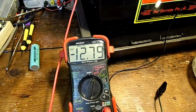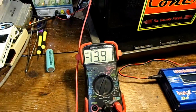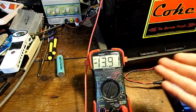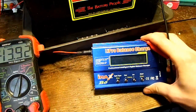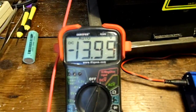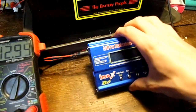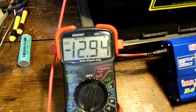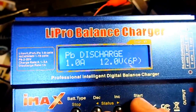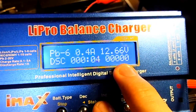So let's top off the voltage, then we'll do a discharge test. We'll charge to maybe 15 or 16 volts and do another discharge test to see what's going on with this battery. For this first discharge test I'll be charging it to 14.0 volts, then when I turn off the charger it'll probably go down to about 12.92 volts. For the discharging I'll be using the discharge feature on my IMAX B6 to count up exactly how many amp hours of capacity this battery has. Now it's at 14 volts. I have it set to PB discharge — PB is lead, or plumbum, the Latin word — and it's counting up the milliamp hours right here.